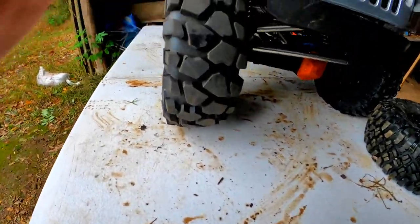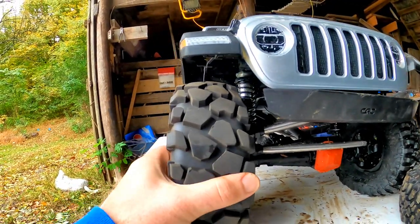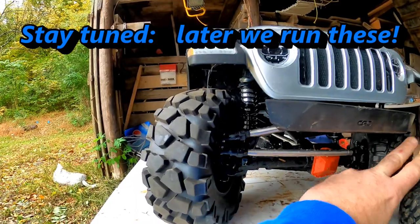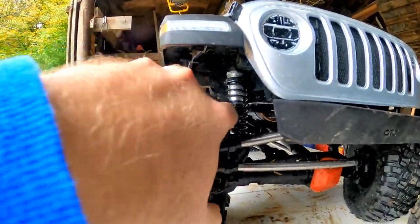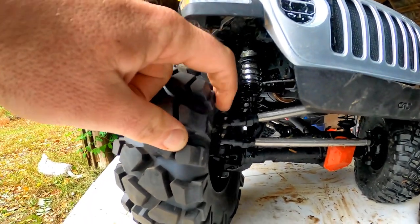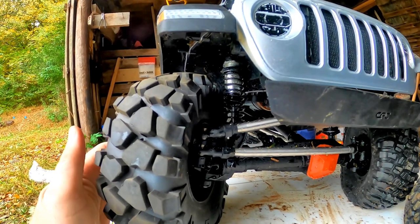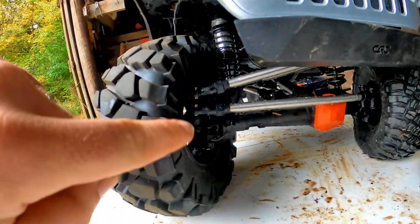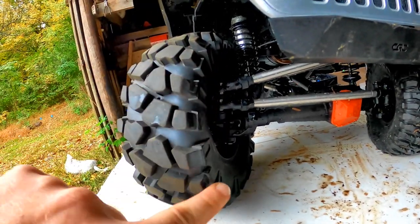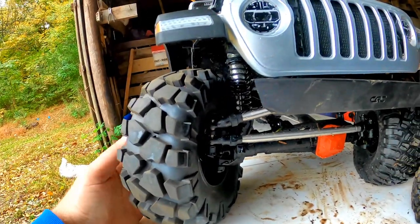The other thing is inside clearance. When you're driving straight, it actually clears everything. When you go to turn, I don't know if you can see this or not, it's kind of dark, but when it goes to turn, the inside shoulder lugs here are going to catch the spring first, which fortunately you're not going to break. But if you came in here and just cut or ground these inside lugs off, that would legit work. That would actually clear.